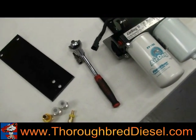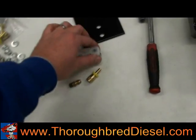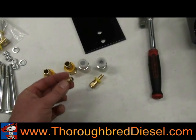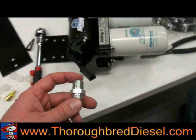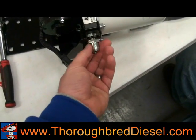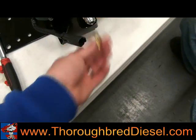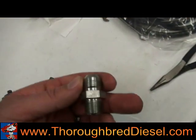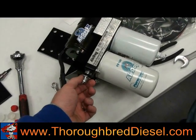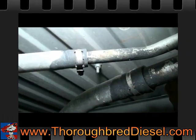You have two red tabs on this side and one on the far side. The six fittings are located right here — they screw in and then the push-lock screws on the outside of those. The small one can't go in a big hole, so you can't miss that. When installing these fittings into the pump, the JIC rounded side always points out as it screws into the pump. The two wrench sizes you'll need are 7/8 inch for the big fitting and 7/16 inch for the small one, or you can use a socket on either one.